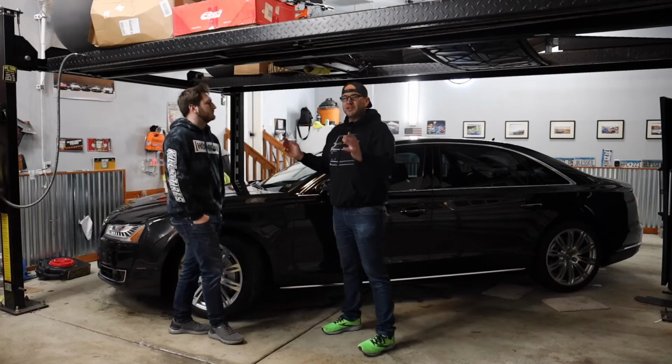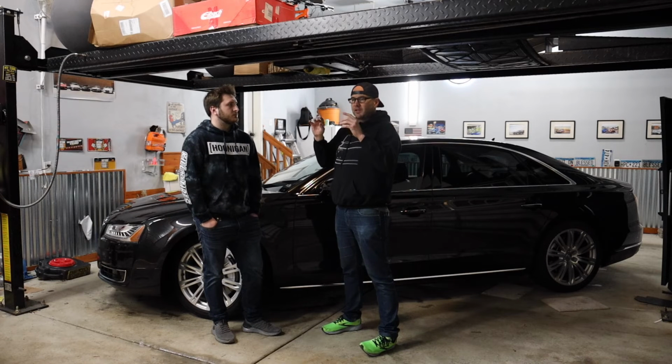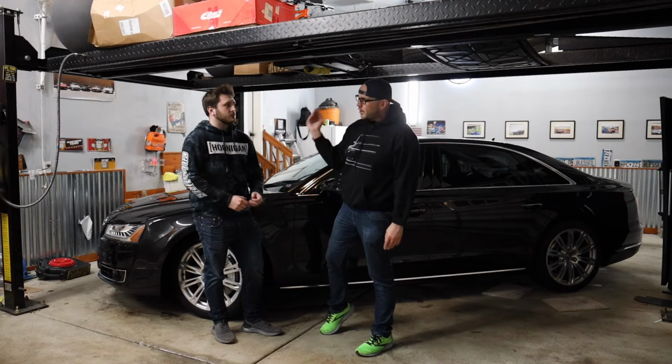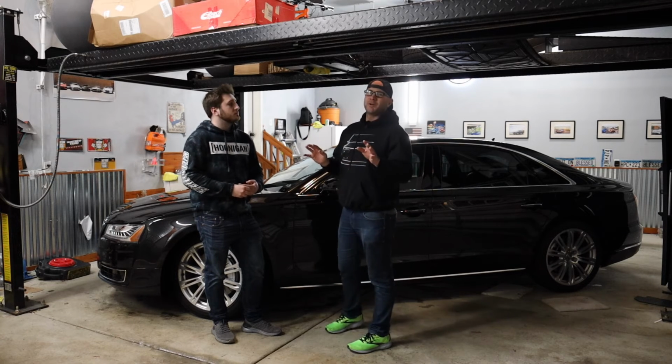There you go. So I take these 3 hose clamps and just tighten them in a manner so they're not touching anything, but they're just putting a little bit of tension towards each other. So it's like adding another layer of support. The vibration is 100% gone, non-existent, can't feel it at all. There you go. It's pretty incredible.